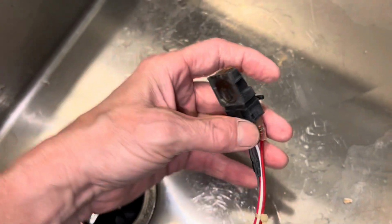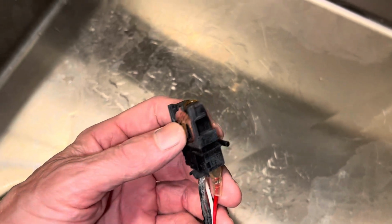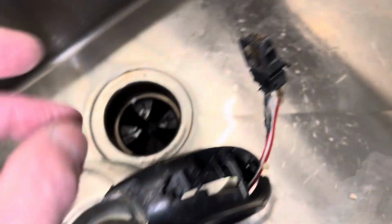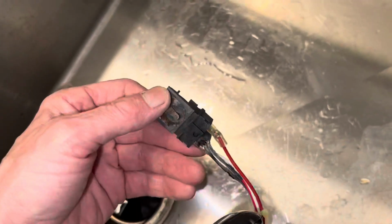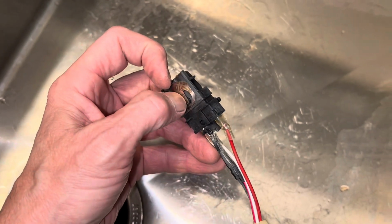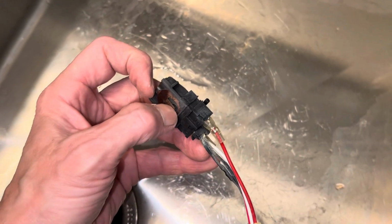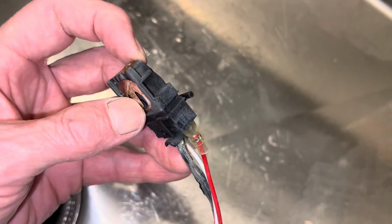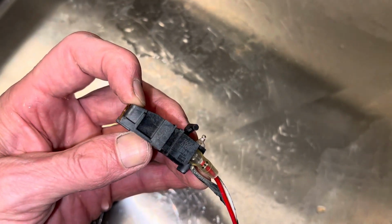There, it's on. Then it has the bimetallic switch in here, and it's pressed up right against the water pot right inside here. And when it senses the boiling water, it gets to a certain temperature. And here it goes. You'll see that little bimetallic metal. The metal will depress on that little button that you see way inside there, just like on a compressor, and you'll watch it kick off.